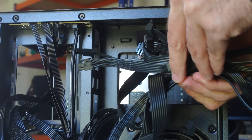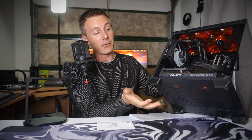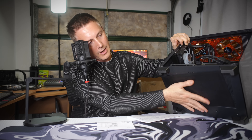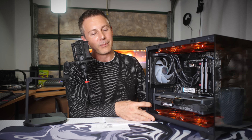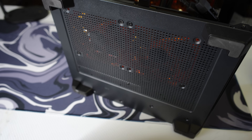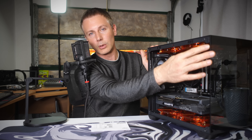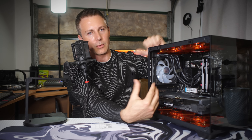Mounting, screws, and alignments — nothing was out of place. The top of the case has a dust filter, but the bottom is missing one, which is a bit disappointing since I've got fans pushing in from the bottom and pulling out the top. If you want to get creative, you can move the dust filter to the bottom of the case to filter the intake air. My second critique is I'd like to see a dust filter on the bottom. The front glass being glued onto the connector doesn't bother me much at this price. For a 240mm radiator it can be a pain, but you should mount that before installing the motherboard. A 120mm is great for mid-range parts.